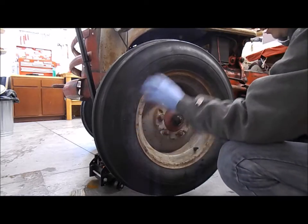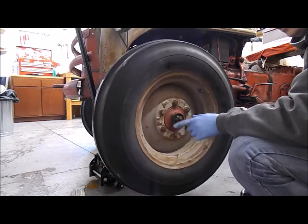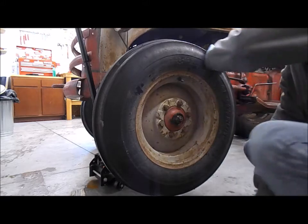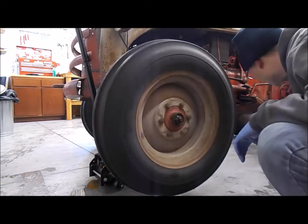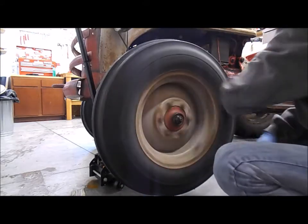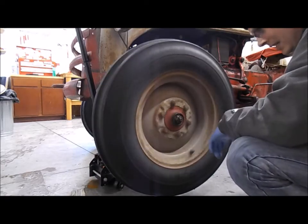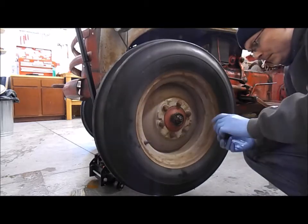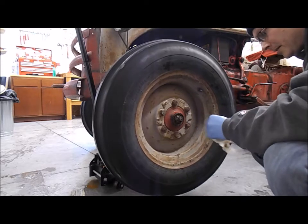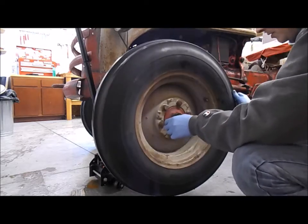I think the other side is definitely too tight — I'm going to have to loosen that. I heard a rule of thumb that it should go about a turn and a half, and then just when it stops it should roll back a little bit. This one feels like it's plenty tight — there's nothing now, that's all it was: the nut was a little loose. It definitely seems noisy to me though — I can hear those back bearings rolling. Probably needs to be greased. It might not be a bad idea to order some bearings and a seal for the back and redo this side. For now I just wanted to get it tightened up because it was not good the way it was loose.